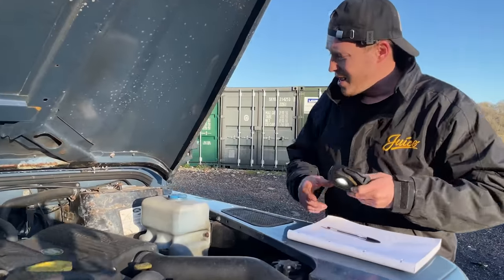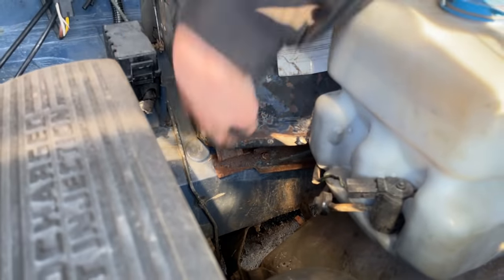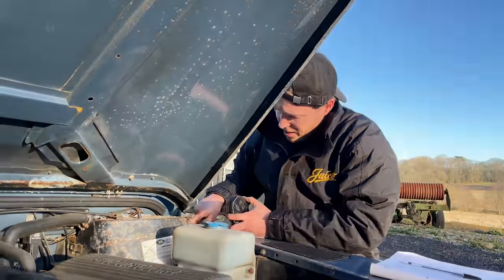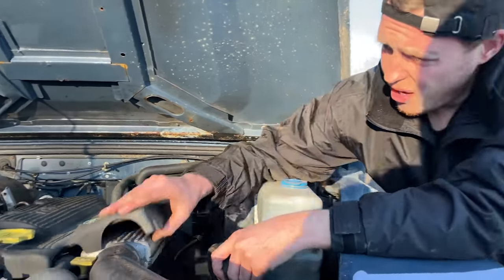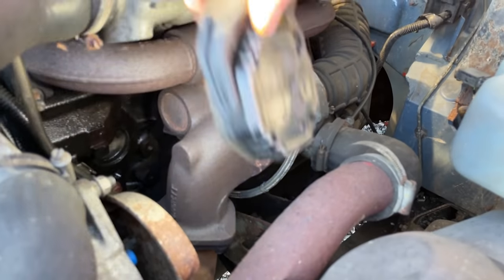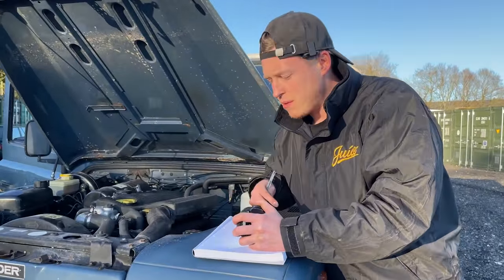A great point in here with the engine on Defenders is you can look at the footwells - this is the bulkhead behind and it would be the same on any Defender with a different engine or variant. Pay close attention to the bulkhead. You can see water is trapped down there and there's a bit of rust creeping in that might need to be actioned. We've got a small leak here on this side of the engine - you can see the side of the engine block is wet. Don't be afraid if you see little leaks like this because it might be a bargaining tool when you make the seller an offer.